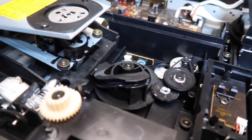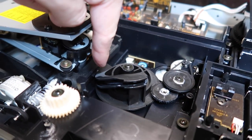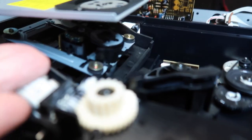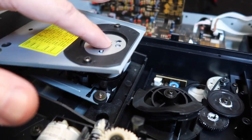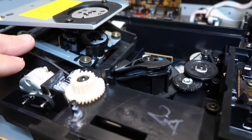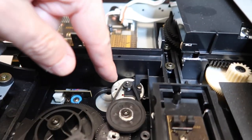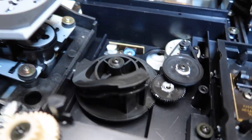I figured out what this motor, belt, and gears are all about — it's one of those things that seems obvious once you know the answer. This motor spins the belt and gears and rotates this tilted piece. There's a little nub that runs in a track up the side and basically lifts the whole CD player mechanism up. This top part is fixed; the center has a little give to allow it to self-center after the CD gets involved. By the time it's raised, it's level. To release the CD, this motor runs in the opposite direction. There's a sensor switch in this little blue piece — that's how the CD raising mechanism works.